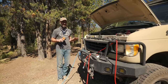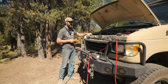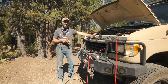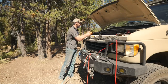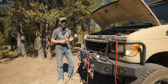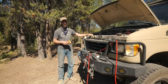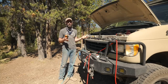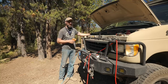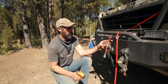Everything is set up. I've got the van on and it's up to temperature, so we're going to do some tests. The van has a 195-degree thermostat, so I'm just going to see what temperature I'm getting on the exchanger itself. The heat exchanger is running at about 165 degrees — and that's hitting the laser on the outer plastic of the heat exchanger. With heat loss going through the plastic, I feel like that's pretty on par. The just-outside plastic of this heat exchanger is running 165 degrees. Now we're going to turn the water on.